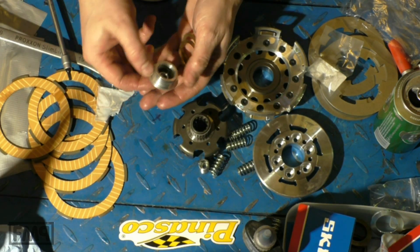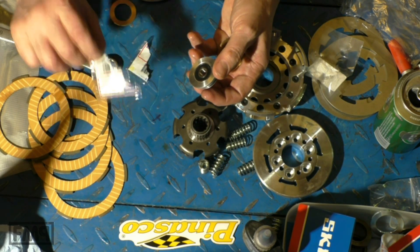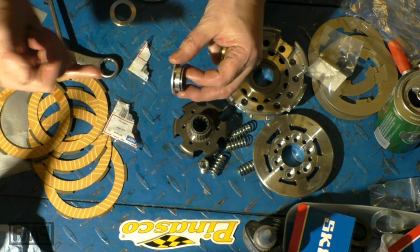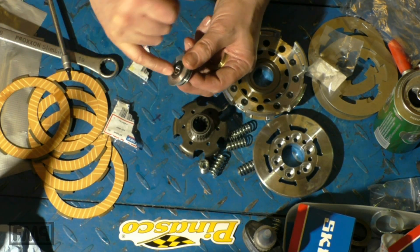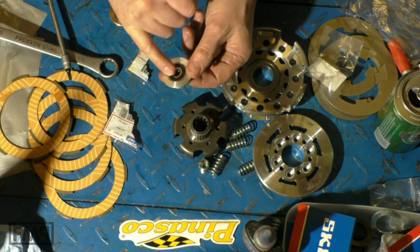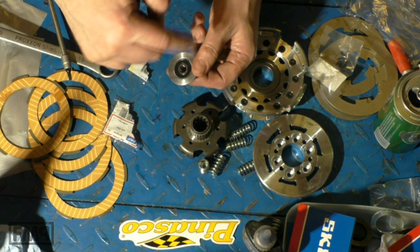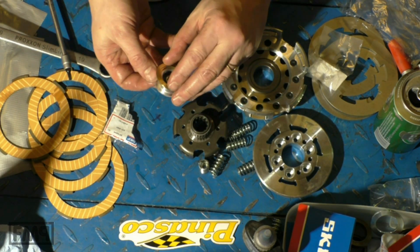Let's sit in here then. That's the pressure plate. It's an SKF bearing. It's not meant to be used and pushed in this direction. But when it turns, it is fine. So do not too often pull the clutch when the engine is not running — you're gonna damage it. As soon as it is running, it's gonna work fine. It's the cheapest solution.